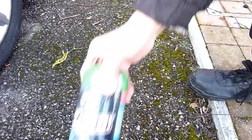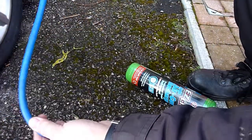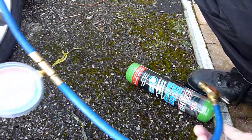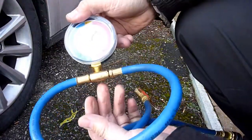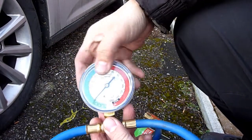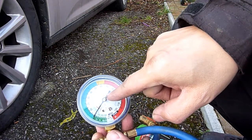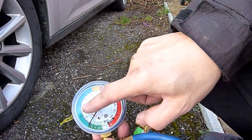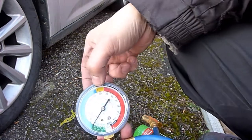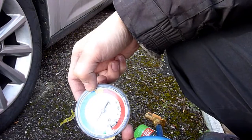While the car is warming up, here's my cable — I think it's about a metre long. It's a bit of guesswork really, how much to put in. Usually being in the green area is good when it's pumped up to the correct amount. I'm going to add R134a. Reading off the blue scale — not the green area, the blue scale — it goes from the lower mark to the upper mark. I want to add to the maximum when it's running.